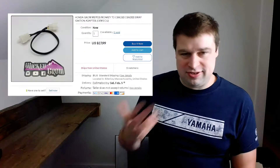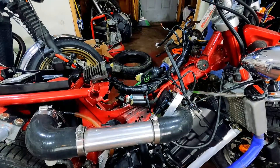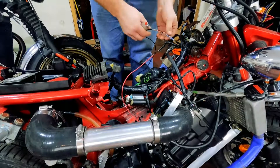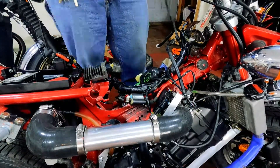If you're doing a Grom swap, I would totally just get this little wiring harness adapter. It's great — it has a Zener diode in it, you just plug it in and it works. Of course, if you're running an A-racer ECU it doesn't even matter, but I'm running the stock ECU, and you need the Zener diode in order to get the bike to fire up. For the ignition wires, they're not in a good location on the monkey where the CBR dash ends up — it just doesn't reach long enough to the ignition coil if you keep the stock ignition coil spot on the monkey. So I had to extend out the ignition coil wires to get a little more play in the harness. The loom was just going to fit to where the coil was — it was on the wrong side of the bike. It's all about taking your time and putting that loom in the correct spots.